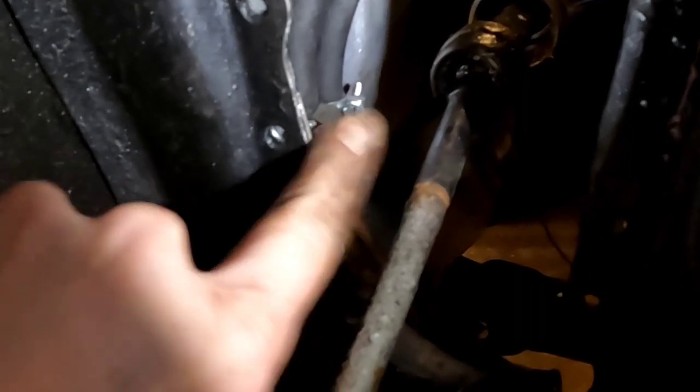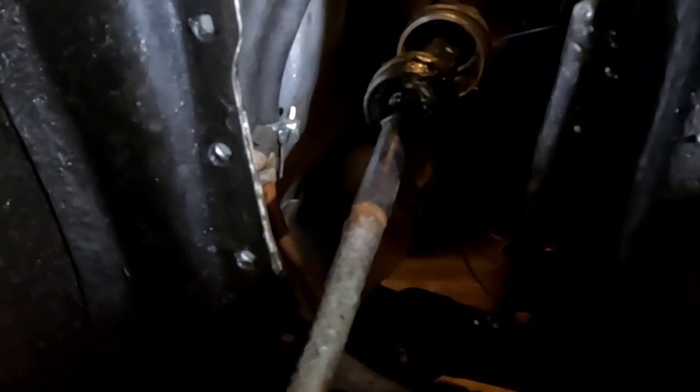We've just tucked the fuel pipes away neatly there as well, and put a different pipe clip on there because they were dragging slightly against the old gaiter, which is probably what burst it. You don't want any of that sort of stuff interfering with each other. So the fuel pipes are all tucked away and they're clipped in where they need to be. And it's just a matter of this thing shoving on past our rack end and getting cable tied into place. But it's nice, it's that stretchy stuff they use with the drive shaft boots as well.